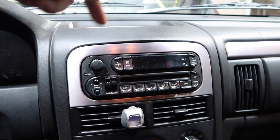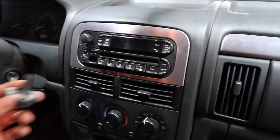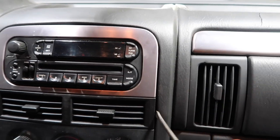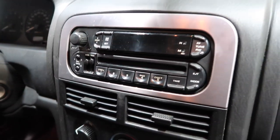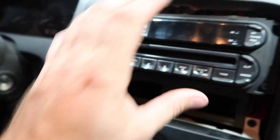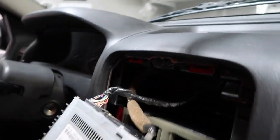Today is the day we're going to fix that. Follow along if you want to do this to your Jeep WJ. First up, we need to get this faceplate trim piece off the vehicle. I can't find my trim removal tool, so we're going to be careful and just pop it off. See, it's already starting to come — just be careful not to damage anything. There it is, it pops free. Now you're left with some exposed Phillips head screws: one, two, three, and four. Then the unit slides right out.